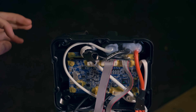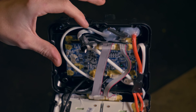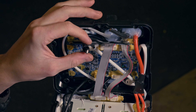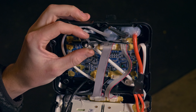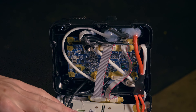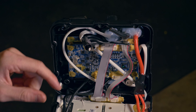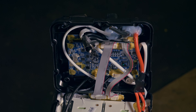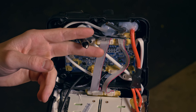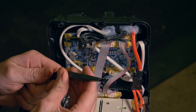Cut the wire on the negative side. The first thing to do is pull those ends so they're bent out of the way of the board and anything on the positive side. The end going back to the BMS just needs to be covered — we're going to electrical tape it off. It'll be inside waterproof housing so the tape should stay put. Now we're going to strip the other wire end. Very important: slide the heat shrink on before you make the connection. The heat shrink is included in the kit.